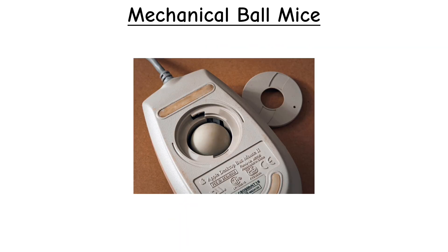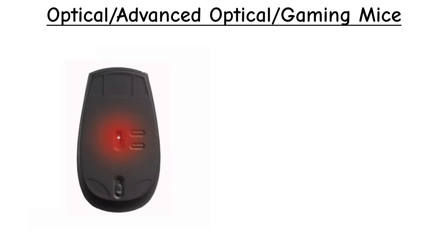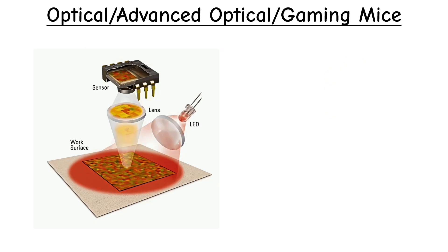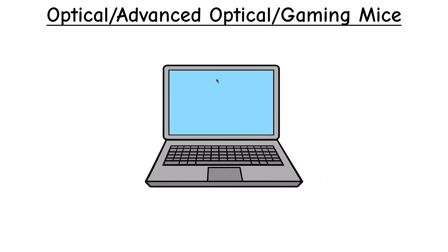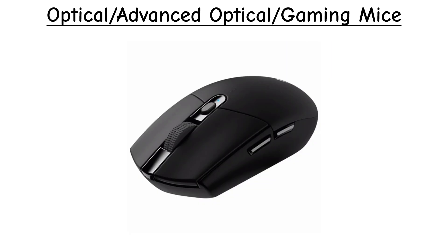Optical or Advanced Optical Mouse. An optical mouse uses an LED — usually visible red or infrared — and a tiny camera sensor that captures thousands of images every second. By comparing the texture patterns under the mouse as it moves, the sensor calculates your cursor movement with smooth, accurate tracking. Over time, this simple LED design became much more powerful, which is where advanced optical sensors come in.